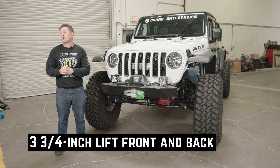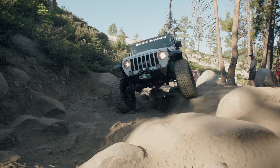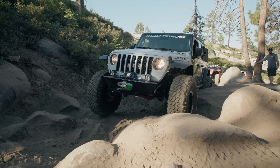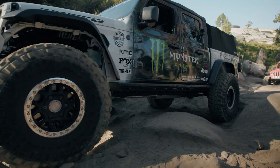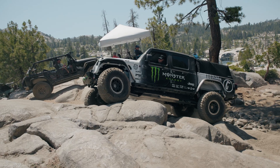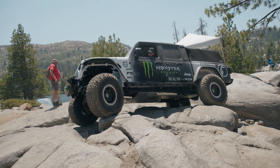Some of the key features with the Portals: it is a three and three-quarter inch lift front and back. So basically if you had no lift at all and you put these Portals and these front and rear ends inside your Jeep, you're going to get three and three-quarter inch lift automatically. That also means that the Pumpkin's front and rear are also getting lifted a little bit under four inches of travel without doing anything. So when you drive over that rock, you got a lot more clearance.